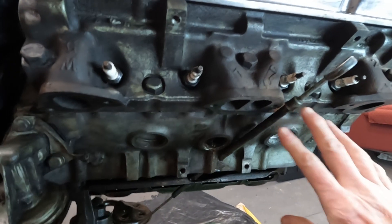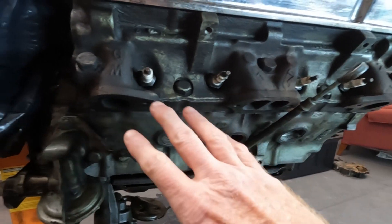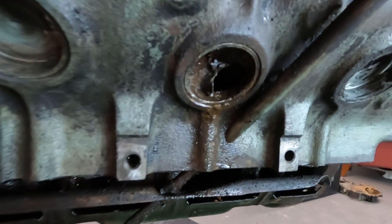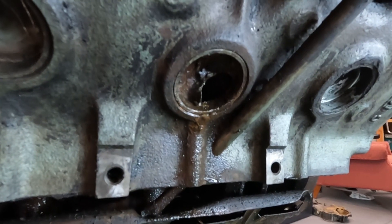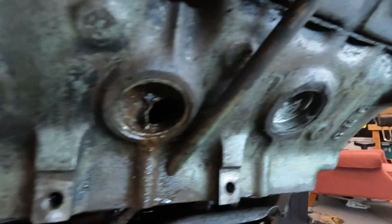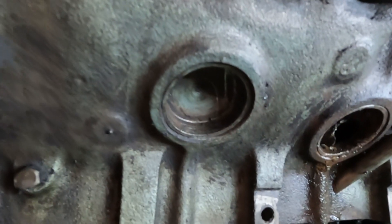A little update: got this side of the engine cleaned up, took the old motor mount off, used the Super Clean. I still got a lot of work to do because it's still kind of nasty. One thing I discovered is that one of my freeze plugs had rusted completely out. The damage you see there is basically me trying to pull it out. I've got a new set on the way, so I'm going to go ahead and replace these even though the others look pretty clean on the outside — I've got to figure there's going to be some rust on the inside. Still making some progress.